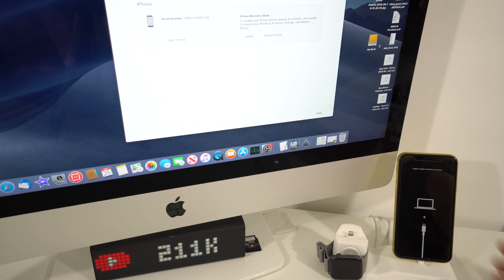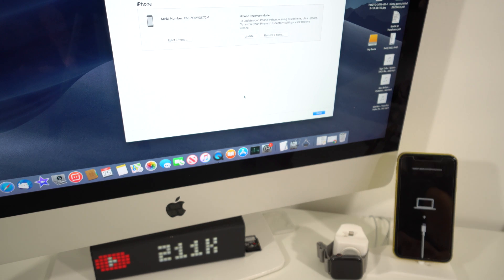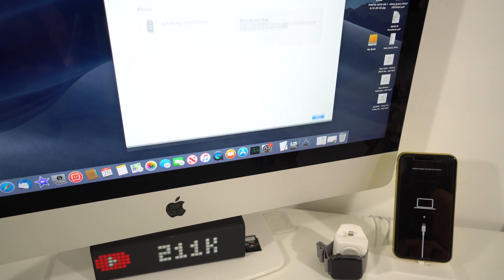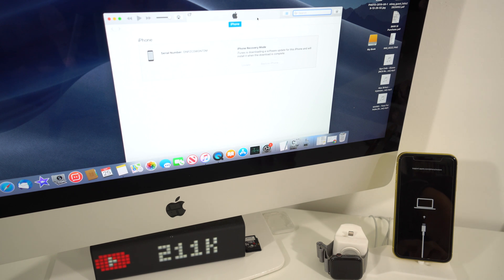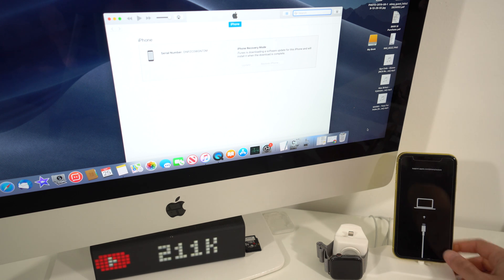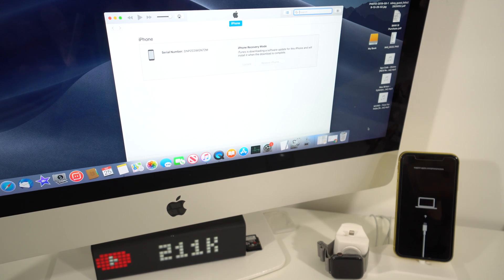Which is restore mode. Once you see that, you should get a message here on your iTunes that says there's a problem with the iPhone that requires update or restore. So hit update, agree, hit okay, next hit agree. It's probably going to want to download the newest software, so as you can see right here, it's downloading the new software update — that might take a few minutes. Once that's done, the restore process will automatically begin. If your phone gets out of this screen, you'll have to follow that step again to get it into this mode, but wait until it's completely downloaded.